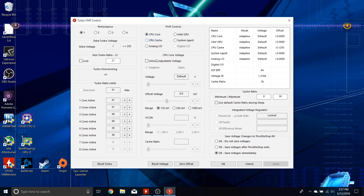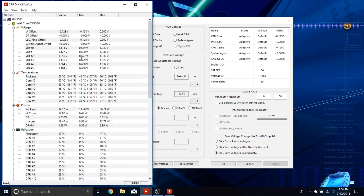Now for CPU core — let's go ahead and unlock it again. One of my favorite things about ThrottleStop is that we can undervolt the cache and core voltages separately, which is really useful. My particular CPU found the best results with the exact same cache undervolt, so for the core I went with negative 125 mV and clicked apply. When we open this up, the same values appear in the IA offset and LLC ring offset.